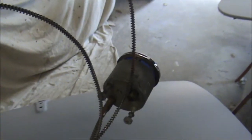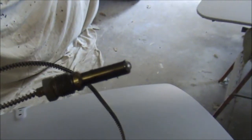Well, I decided actually that this temperature gauge attempted repair isn't really going to work. It's probably beyond me. I can only get it to read up to about 140, 150 degrees in boiling water. I think the problem was that I couldn't really solder up this bulb without losing some of the ether, possibly because I'm not good enough at soldering. Well, I have done a fair bit of it, but just to try and keep the temperature down in the bulb was a real problem.